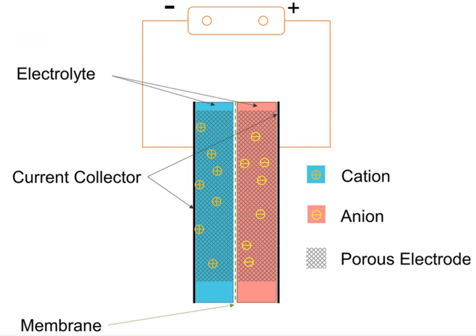The fuel economy improvement between a capacitor and a battery solution is about 20% and is available only for shorter trips. For long-distance driving, the advantage decreases to 6%. Vehicles combining capacitors and batteries run only in experimental vehicles. As of 2013, all automotive manufacturers of EV or HEVs have developed prototypes that use supercapacitors instead of batteries to store braking energy in order to improve driveline efficiency.